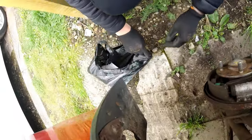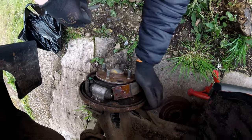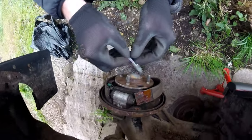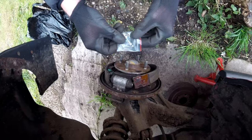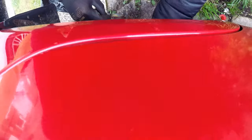Okay, so as you saw from the last clip, I had some issues, let's say, with this drum brake. Now, what I've done is I've gone home and I actually picked up a few washers just to test fit some. Because that way the diameter of this pin is increased, hence eliminating said problem. And let's see if this has fixed our issues. We've got our hole there.